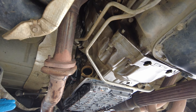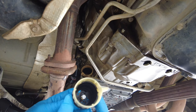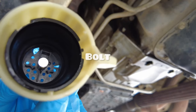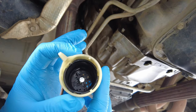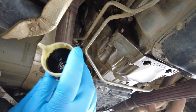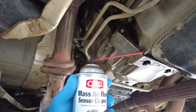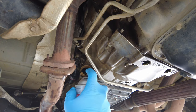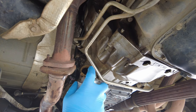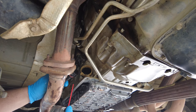I've spent some time under here wiping everything down. Now I'm ready to remove the adapter plug. Looking at the new one, there's going to be a seven millimeter nut right in the center. We need to make sure that the rotating locking ring is all the way in the counterclockwise position, and then take note of the orientation so the new one duplicates the same position going in. I'm going to start with some mass airflow cleaner and clean the surrounding area really well, letting it drip down into the pan.